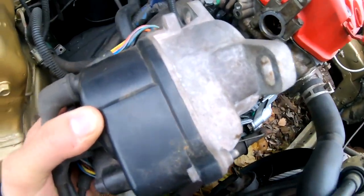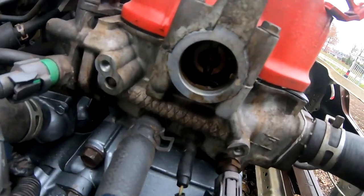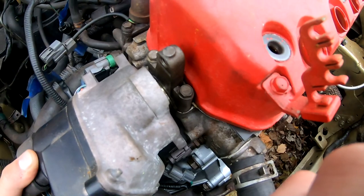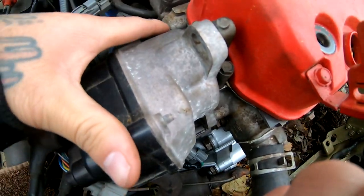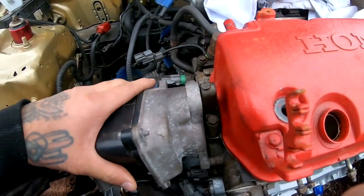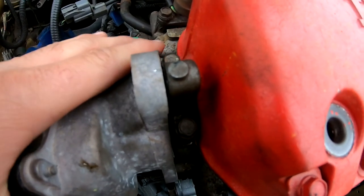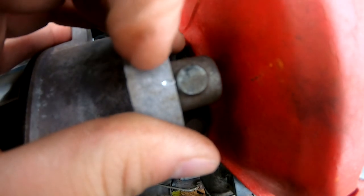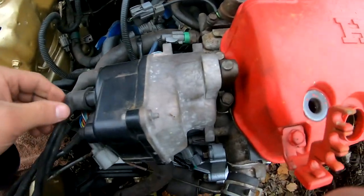So the distributor should just slip in there just like this. You guys can see these two little marks and there's a little line in there. We are going to put our screws right through here in all three spots. When I first tore the engine apart, I marked it — I put a little mark right here with the screwdriver and a hammer so I would know where my mark would be. When it was time to reassemble, I could just line up those two little marks together and my timing wouldn't be so screwed up to begin with.